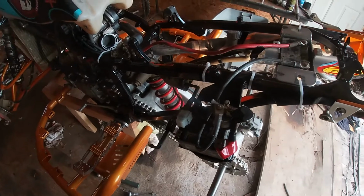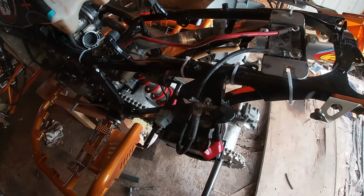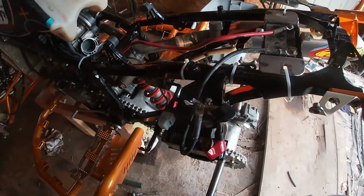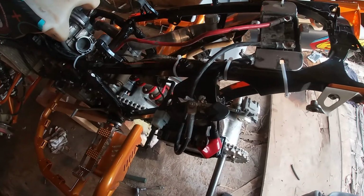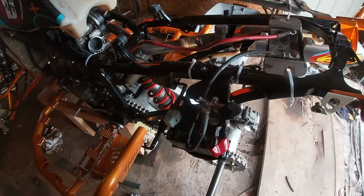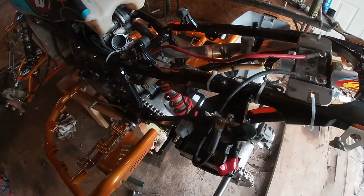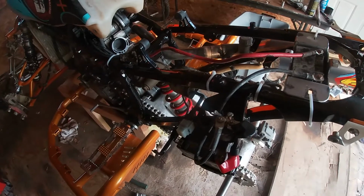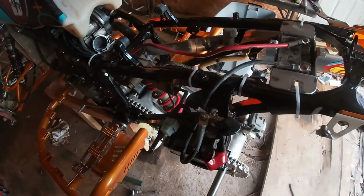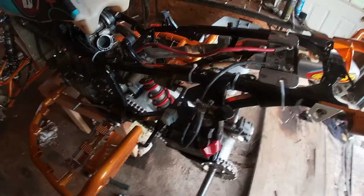It makes a tremendous difference on hot starting them if you stall it out after you've been riding for a while. And with XC racing, they're all dead engine start, so it brings it to life a lot quicker on the line. It allows you to run the decompression lever just a little bit higher. This is on a manual decompression lever. It's an 06. So I set mine with a gauge at about 60 PSI, where I think the factory spec has it at around 50. So it allows you to run a little bit higher, so they start a little bit better.